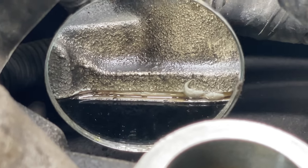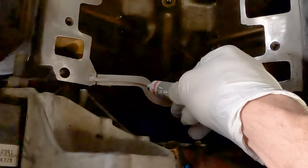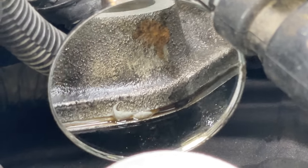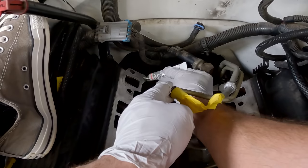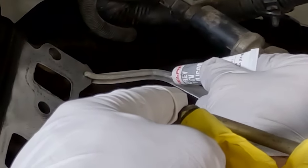Just a few weeks ago and about two videos ago, I replaced my entire intake manifold gasket set. Along with that job, you do have to use gasket maker to seal the front and back of that intake manifold. Looking at the rear of this intake manifold with the mirror, you can see a little bit of that gasket maker popping out there, but you can also see some oil right there on that edge. That gasket maker — I just didn't do it right. I didn't put enough on there. And unfortunately, because of that one small detail, I have to redo this entire job. And it's a big job. If you haven't seen that intake manifold gasket replacement video, I'll link it in the cards above and in the description below. That was a tough job — I waited a long time because I knew it was going to be a very involved, difficult process.